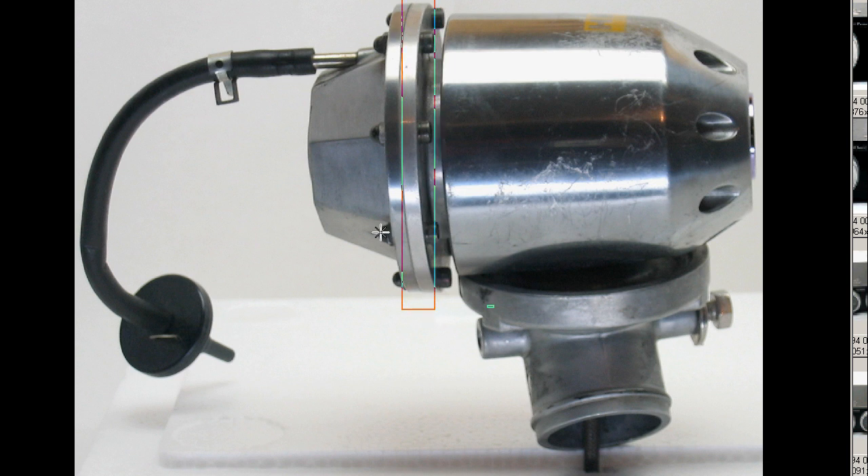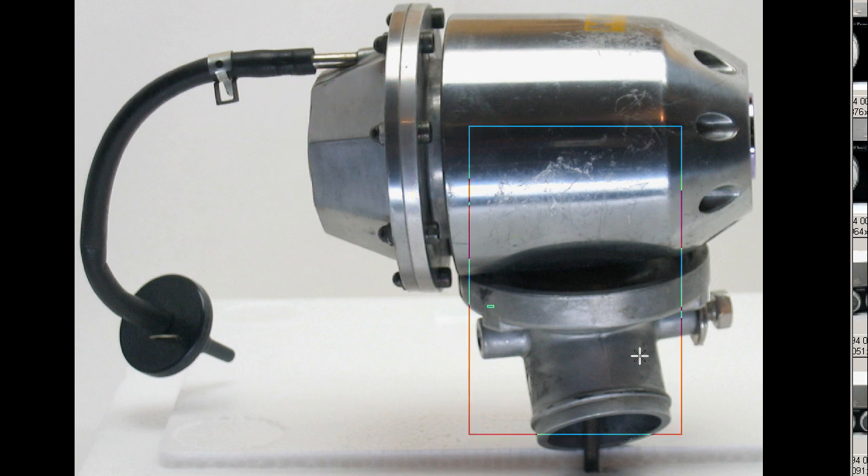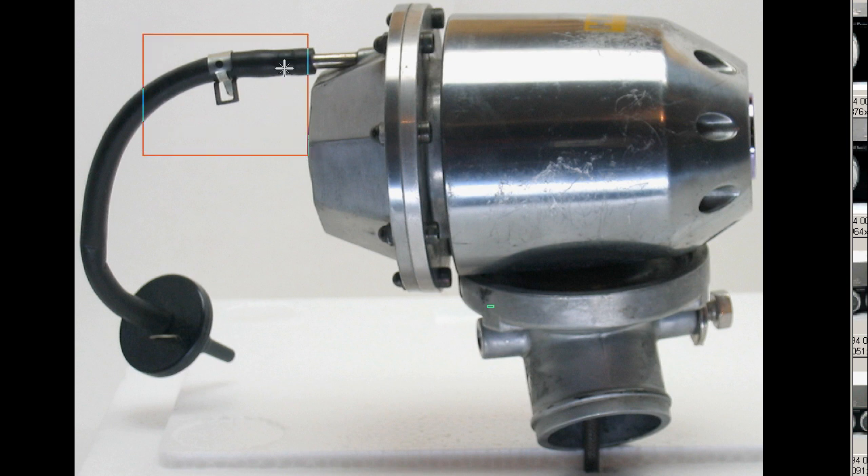The diaphragm is in this area here. A spring resisting the movement of the diaphragm is in this area here. Boost pressure from below, and the intake manifold vacuum also pulls on the diaphragm. When the intake manifold vacuum plus the boost pressure is enough to overcome the resistance of the spring, the diaphragm will move backwards.